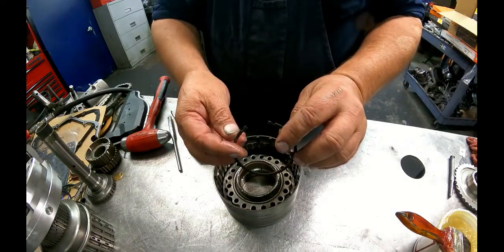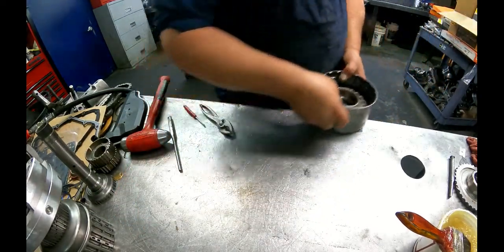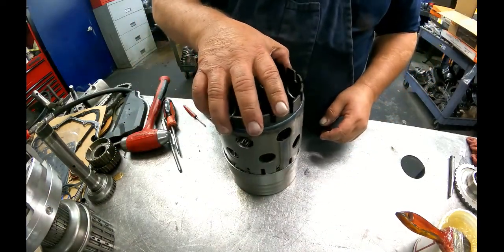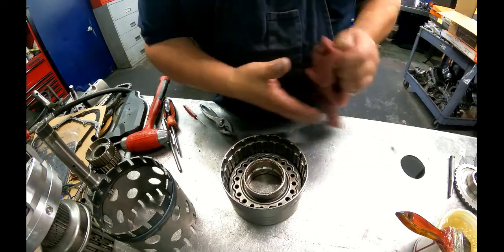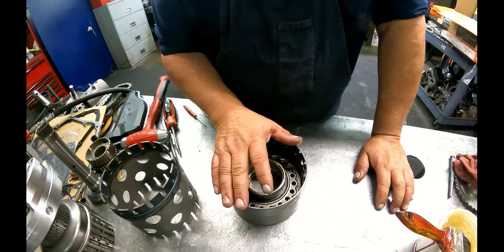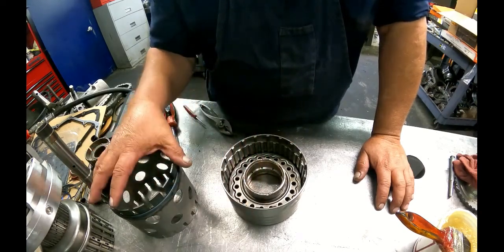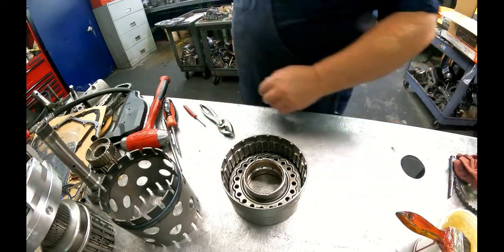Turn spring, short end of the taper up. Now the teeth on this drop, and the teeth here where they mate. The early ones were 25 degree splines, and they were really bad about wearing the lugs out on here and on here. The updated is 10 degree, and I recommend you put that in there, especially if it's a heavy duty unit or you're going to be putting a lot of torque on that, because it will screw them up if you can possibly do it.